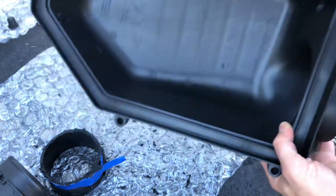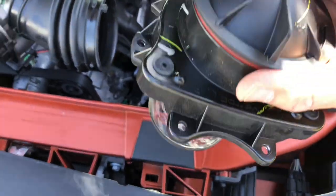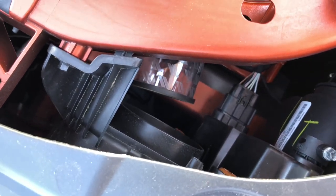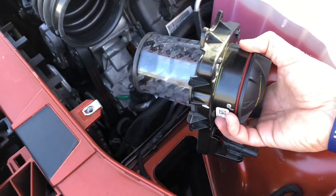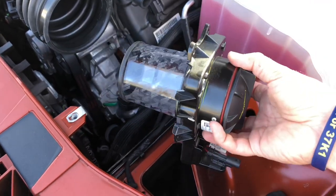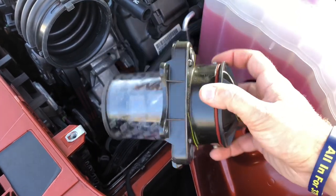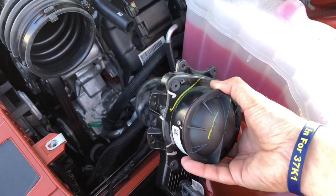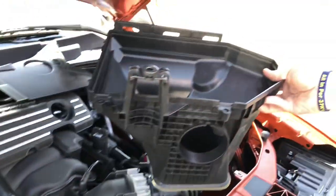Now for removing the cap behind the headlight - I removed the whole light assembly, which is held in with about six small screws all around. Once you take the six screws out you can slide the whole thing out and unplug the harness. Everyone complains about those two very small Torx screws - by removing the light assembly first you can work on your bench instead of struggling bent over into the hood to access them.